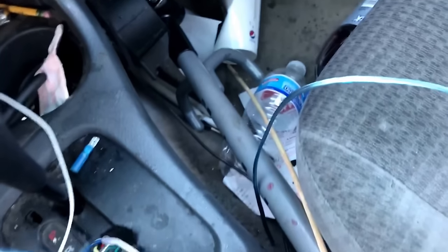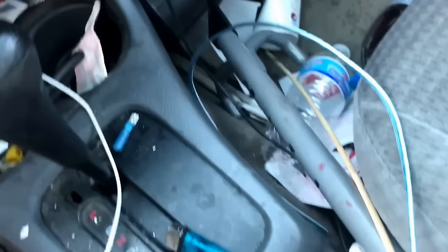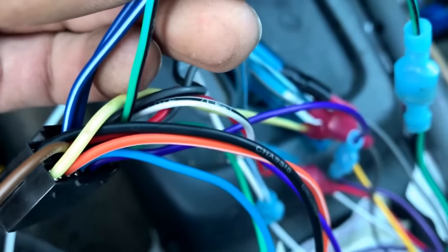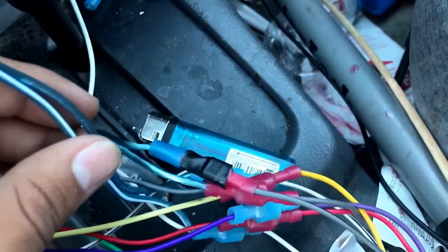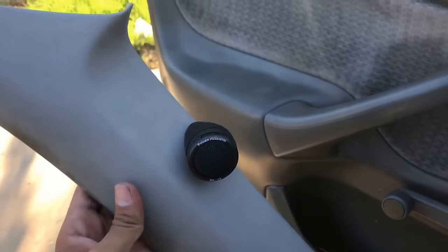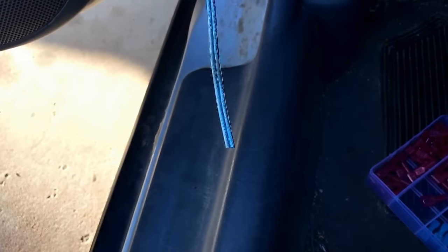As you can see right here, I got the connections and I'm connecting it straight to the connection that goes into the system — the head unit. I look for the wires, it tells you right here like left positive and all that. So I'm using the front left positive and front left negative. The one with the line is positive and this one is negative. I already ran the cable over here — I have the tweeters mounted right there, easy, just one screw. The cable runs through the back, and then just put a metal connector in here, connect it, and you're ready to go.